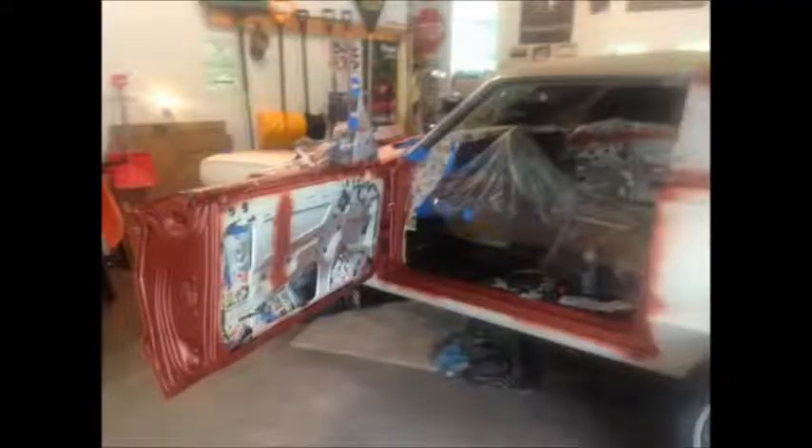Cutting in the doors and door frames in the Ember Glow. This is a home restoration project — I'm using newspapers and plastic, and this is going to be a driver-quality restoration. Some more cutting in on the door frames. I took my time on these little projects — taping everything off, removing weather stripping, etc. It all came out very well. You wouldn't have known that this wasn't a factory Ember Glow car without really seriously tearing it down.